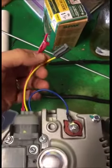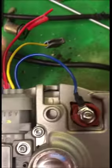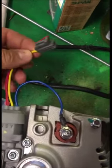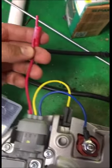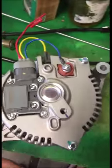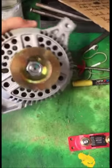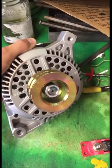So you have here an A, S, and I connector on the pigtail. A goes to your positive terminal, S goes to the stator right here, and I is ignition - which is the green-red wire on the voltage regulator. You just splice that wire in and you're ready to rock. The reason to do this is it's a much more reliable system that produces a hundred extra amps.